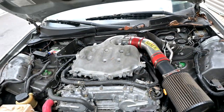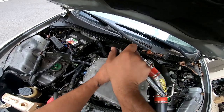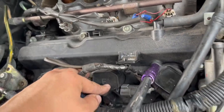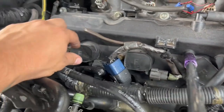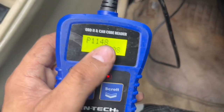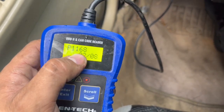Of course I left my drill in the Chrysler. I'm going to start by pulling all the coil packs off and swapping those out. It's an intermittent issue that randomly comes and goes - sometimes based on heat, sometimes based on RPMs. I hooked up the code reader and I've got eight codes. P1148 and P1168 are air-fuel ratio errors with sensors.